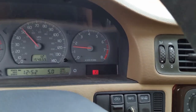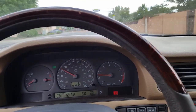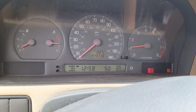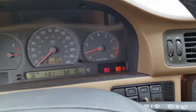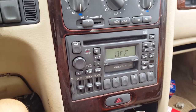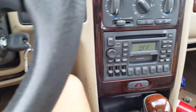There she is — we got ourselves a blinking check engine light just for a moment there. It still cruises like a beauty, I gotta tell you. These cars are so comfortable. Oh man, this is so frustrating. The oil light just blipped. Looks like the misfire's gone — I need to add some oil. Okay, misfire's gone for some reason. The check engine light's on, which is good — I can diagnose it from there. Huge oil leak. And the radio says 'off,' which means somebody put in the wrong code too many times and it's locked itself out. I've heard you have to leave the key on for 45 minutes or go for a long drive for it to allow the code in again.